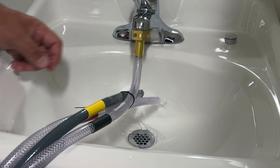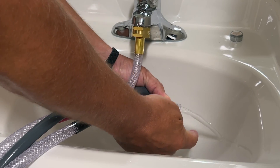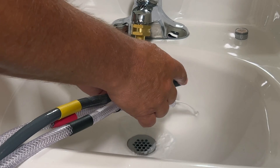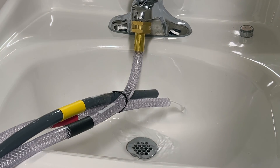When the air conditioner is operating properly, warm water will be discharged from the water tube into the slop sink. It will be approximately 105 degrees. The drain tube will only discharge water when the condensate tank is full and water needs to be pumped out.